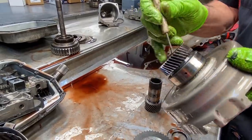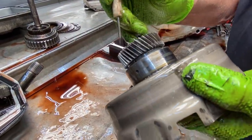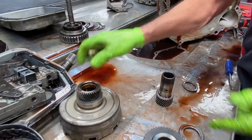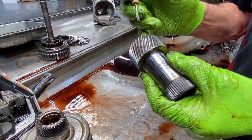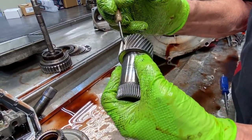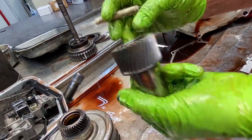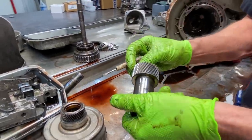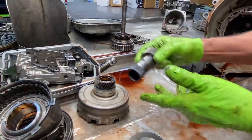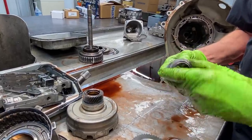On these shells right here we always see a ton of wear on this gear right here — you can see the wear. We replace every one of these. We also replace this bottom sun gear — you can always see the wear that starts in the very middle of the gear. They wear on one side more than the other, but we replace all these right here. Also check this little bearing right here too, make sure it's in good shape.